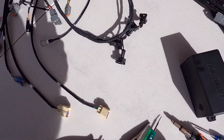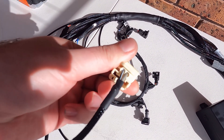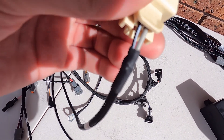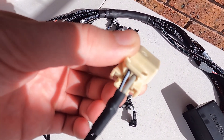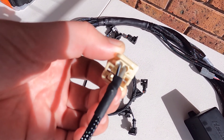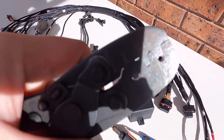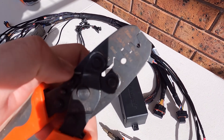The knock sensors — this one here — these are actually for an LS2 knock sensor which will be adapted to the big block. If you can see inside, there are seals, and on the end of the terminals there's a seal. That's when I use those round indents to just crimp that seal on.